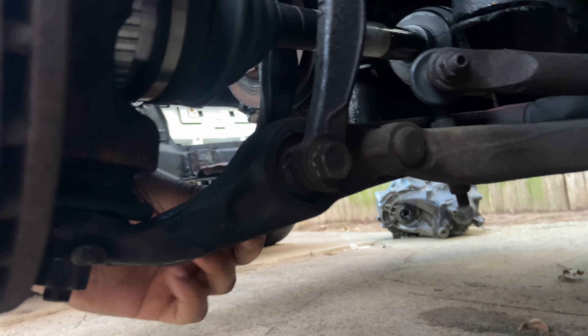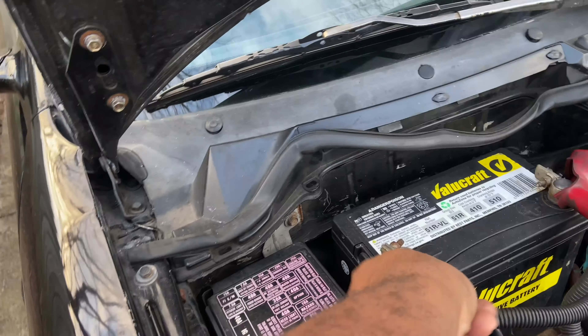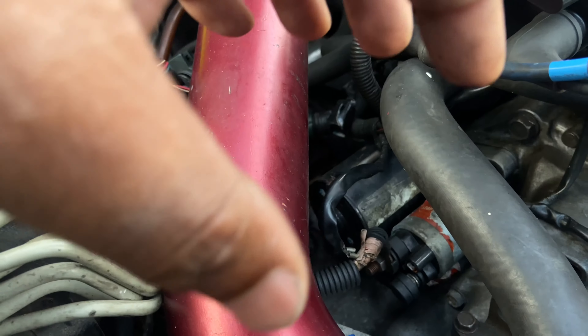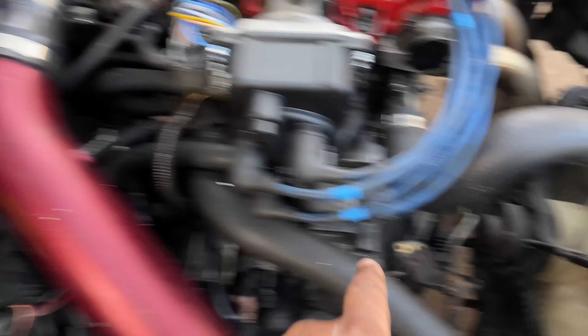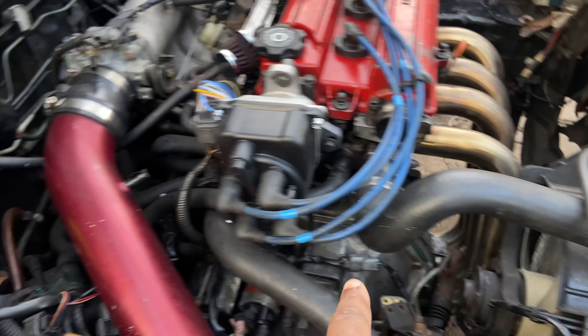Two 17s down here, the 14 for the half shaft bolts. Definitely disconnect the battery, disconnect the starter, and the bitch pin — which is the annoying thing to do when dropping the transmission. That's why they call it a bitch pin. Then the 17 bolts around the housing.